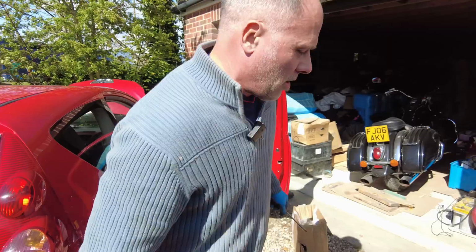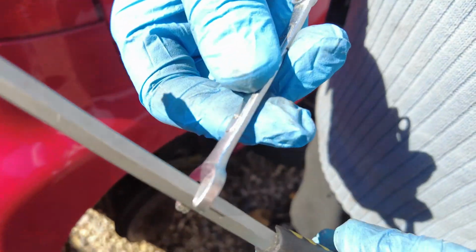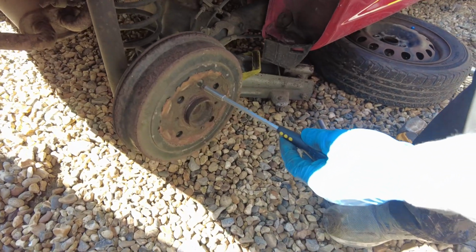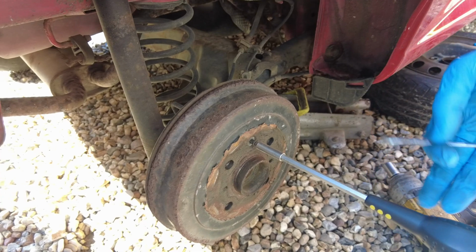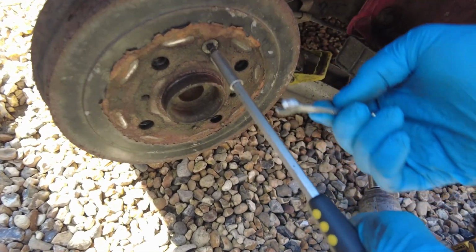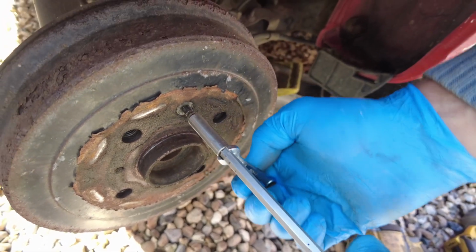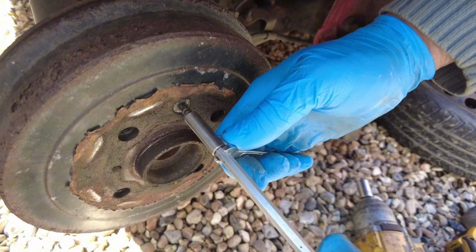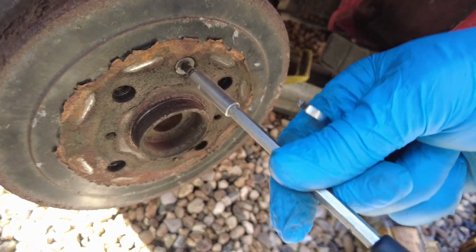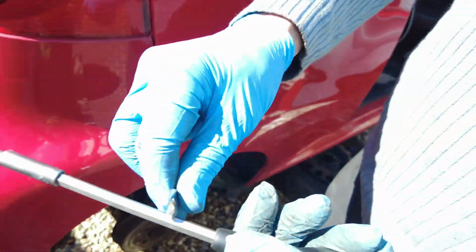Right, she's tough. So I've got an impact wrench inside. I can't be able to get it. Little 6mm spanner fits around there. That's why these are like that, funny enough. A lot of pressure, push into the car, a lot of pressure, keep a good firm grip on it. And then as you're pushing and turning, see that? And that is all it took to get that off. 6mm.